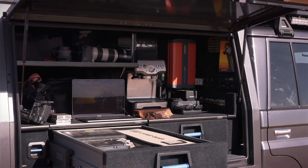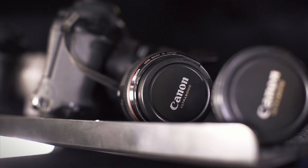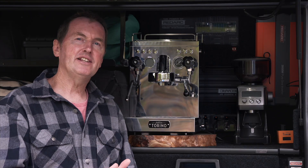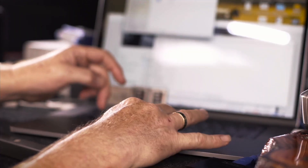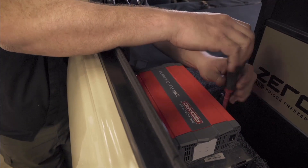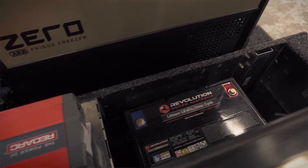With the camera truck we're charging up all sorts of massive batteries for lighting, cameras, drones and the works — plus we run a coffee machine. In the Sandy 60 we need enough power to run the fridge, charge people's phones, charge camera batteries, and run the lights. A 700-watt inverter and a 100 amp-hour lithium battery will be heaps of power to do the job.